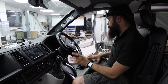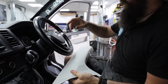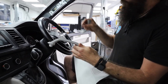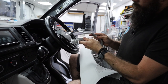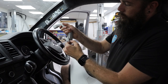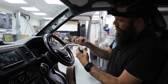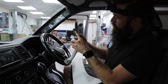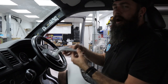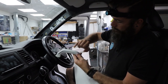I've just removed everything I need to remove in terms of the A-pillars. Once you've taken off the handle — which we've shown in videos before — it just has a covering bolt. I use a slim trim tool into this little gap here. This one's been off before and someone has broken a couple of the little legs, which is why it fell off so easily. Be careful when taking it off that you don't crack the sides, especially on a cold day — they can fracture.